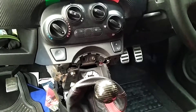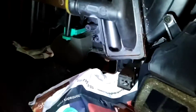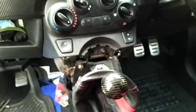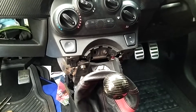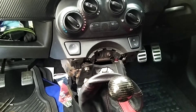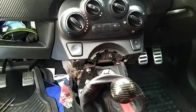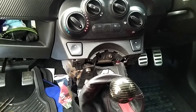This is a 2012 car which has got the fibre plastic pipes — the later ones have alloy. You can see it dripping. The actual matrix has had a bodge repair before. It was a temporary repair we did about four years ago and it started leaking again. That was the other side of the engine bay, the engine bay intake pipe. We bodged that when it started to crack, and now it's started leaking again from the actual matrix.